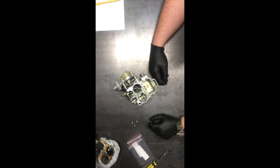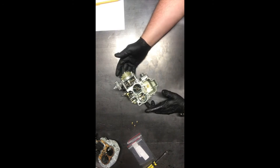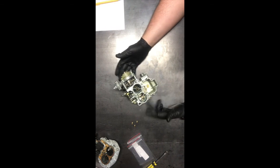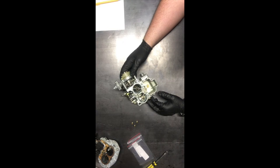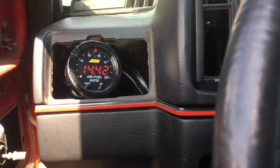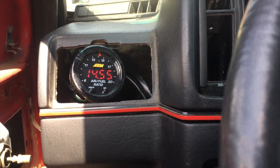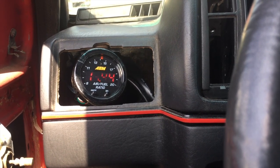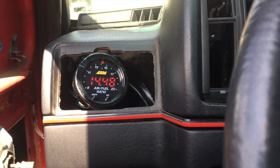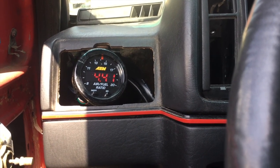Hopefully this will get me a lot closer. I hope this helps somebody out there that's fighting one of these — I saw a lot of people online having the same problems with really no solution. After putting the re-jetted carb on, it was actually running a little lean. So instead of the 125 on the primary main, I switched it to the 130. Now I was actually able to adjust idle and the mixture screw to get where I am now. I haven't done a cold start yet, but I imagine it's probably going to be alright. This is definitely promising — give it a try, hopefully it works for you.